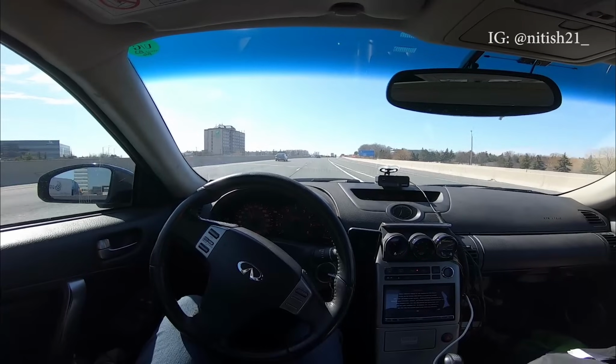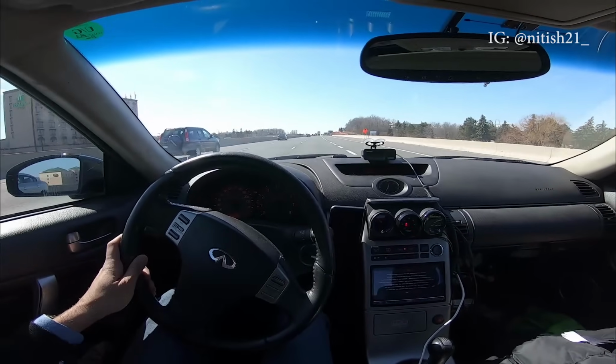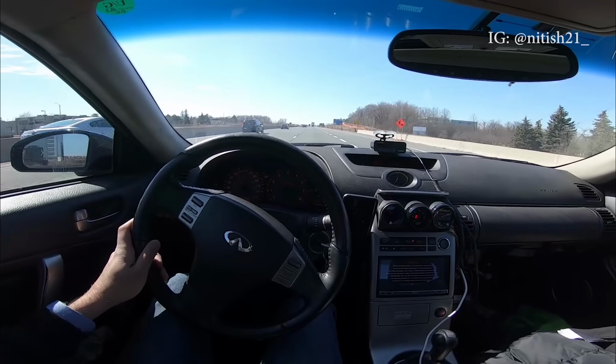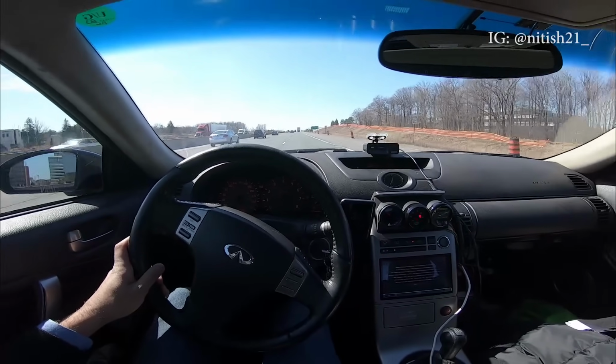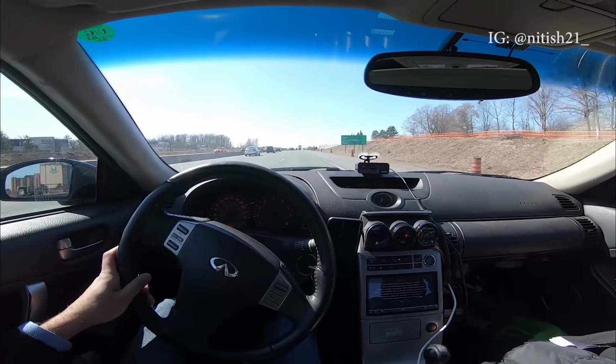You can make a much broader power band on the VQ than you can on the 2J. In my opinion, sometimes I see 2J dyno graphs and they look a lot more like dyno queens, just making a ton of power up top, turbo lag. So I do think that the VQs have a lot more potential in terms of a broader power band, right?